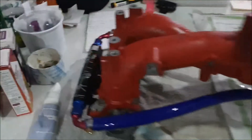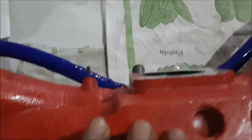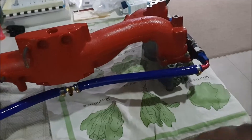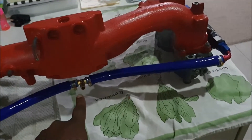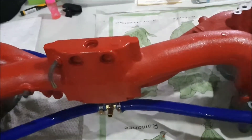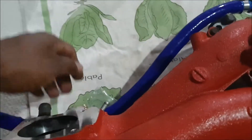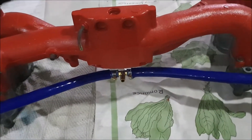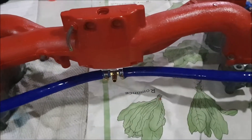That's all done now. So that's the throttle body at the back, and this is the front. The fuel line comes in from the fuel filter, goes to a T-connector, and fuel goes into both fuel rails at the same time. Fuel travels through the rail to the back - again both sides - then comes to another T-connector. From there it goes to the fuel pressure regulator, and from the fuel pressure regulator it gets returned back to the fuel tank.